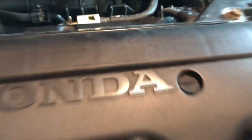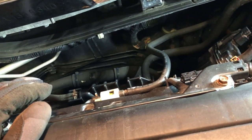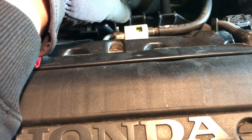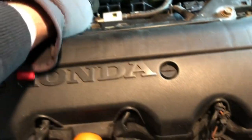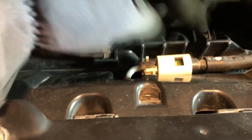There's a little white clip here to remove — this is part of the fuel rail. It is recommended to relieve the fuel pressure by removing the fuel pump fuse. The fuel isn't going to spray everywhere; when I did it the first time it just kind of leaked out. So have some paper towels stuffed in the areas around it because some fuel will come out. Just use a flathead to push that little clip and it'll come up. Use one flathead to push back the little piece and another to pry upwards — be very careful as it's old plastic and can be brittle.